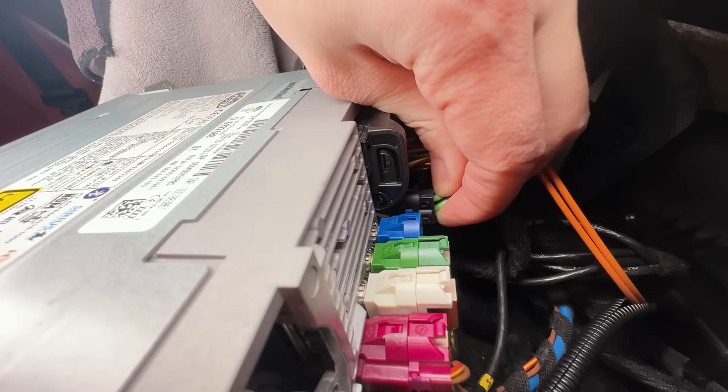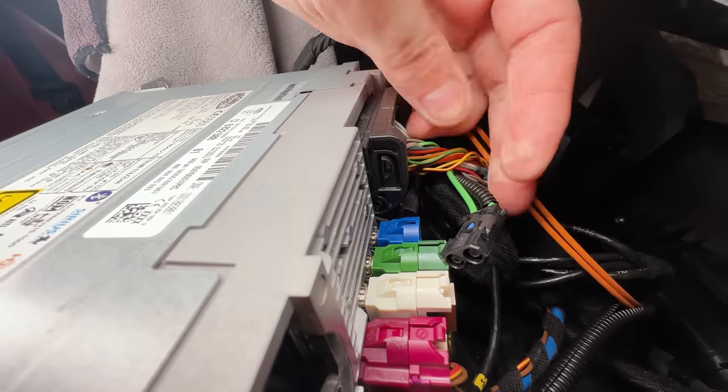This was one of the most difficult installations I've done to date. Going from the base analog cluster was a lot more difficult than videos I watched where people were going from the 6WA to the 6WB. I had to learn how fiber optics work, find the three-way fiber optic cable that would connect the 6WB into the car's existing fiber optic loop, and even coding it was challenging — ultimately I had to have Beamer Geeks go in and code it for me remotely.